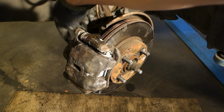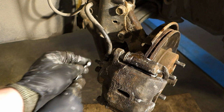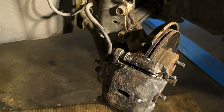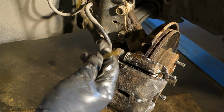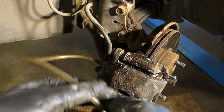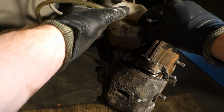And after that I take and open that bleeding bolt in here. There is this bleeding bolt, and it's 8 millimeter. When I open that, I need to next insert this bleeding hose in here. And it looks like that. Then I check that it must be a little bit open, and I insert this plastic hose in here, and it goes in this area. Look, in that way. And the free end goes into this brake fluid container, in that way.